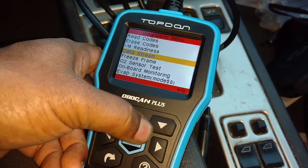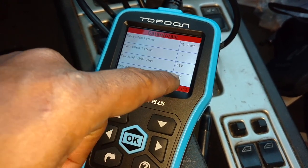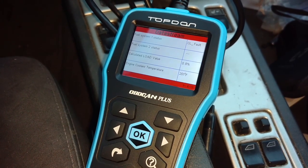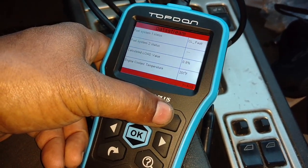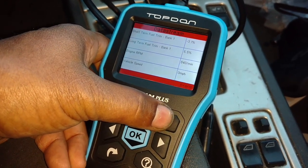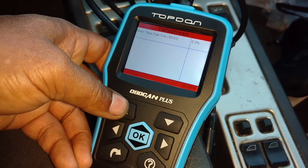I'm going to go to the data stream, view all items, and see if my temperature is in Fahrenheit this time. Yes — 208, 206 degrees. So you may want to go through that setup screen and make sure it's in the language and numerical values that you need. You can also check this thing sometimes and see what your actual miles per gallon is while you're driving. Let's see if it's on the next screen — RPM, vehicle speed (you can check that against your GPS), flow rate, air flow. I don't see the engine miles per gallon on this one; it may be in a different setting.